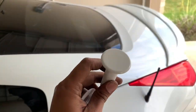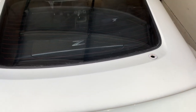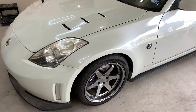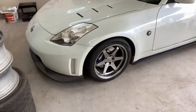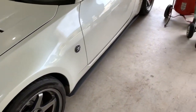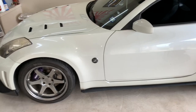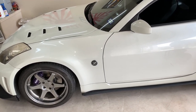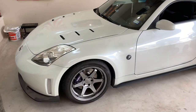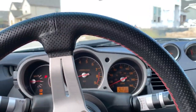Finished clearing up the painted cap — we'll throw this on there real quick. Not sure if this will be in the video or not. I thought I was done, but I tried moving the car just a little bit and the pedal just feels way too soft. There's definitely air in the line, so I gotta bleed the brakes again. Jacking the car back up — I thought about leaving it for another day, but I'm pretty much done, so let me just get it done.